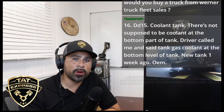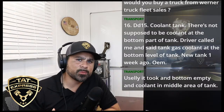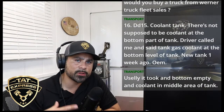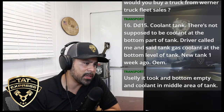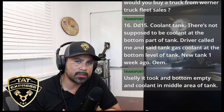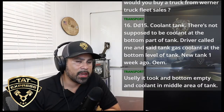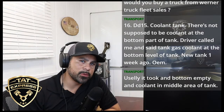In a video that we're going to be sharing with you in about a week or so, there's a DD13 that came in where the head was pretty solid. For some reason, another shop pulled the head, suspecting that fuel was going into the coolant, saying the head was cracked. We pressurized the head and it didn't have any leaks, so we were going to go back on with it. A lot of times, if you have cross-contamination from diesel going into your coolant, it's going to be injector cups, and that's something you can easily check without pulling the head. So we were confused about why they pulled the head.